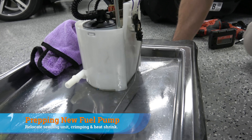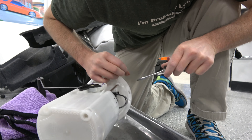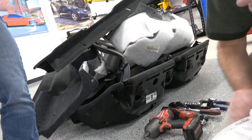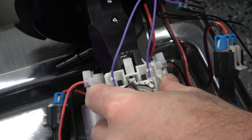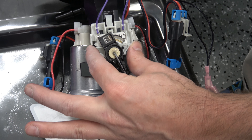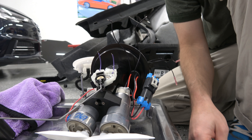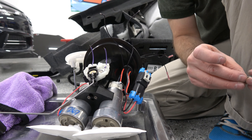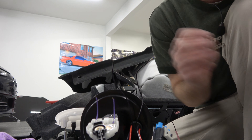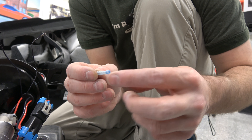Now the goal is to remove the sending unit — these I always break. Shelby is a certified NASA engineer so we're going to let him attempt this. We need to splice into these connectors — they're called environmental splices, for joining wires with an environmental seal. It's like a built-in heat shrink; the little tubes on the ends will seal it completely when shrunk. Blue ones use the middle crimp position.